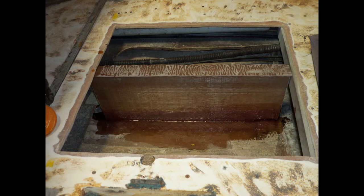The replacement floor — the floor that came out of there — will get glassed back right over the top of the hole. Note there's plenty of room for air to flow. You don't want to fill this cavity with flotation foam up to the top. Some people have asked if they can just fill the entire area with foam to support the floor — the answer is no. Ventilation air coming from the forward ducts must travel through this area to get to the engine compartment, so it must be left open to allow air to flow through.